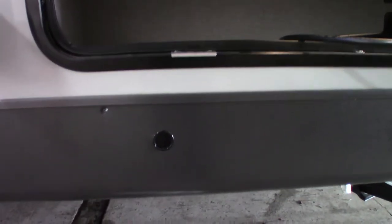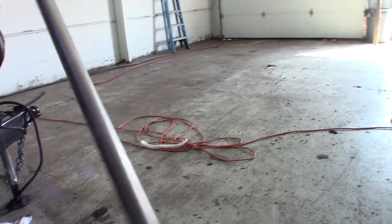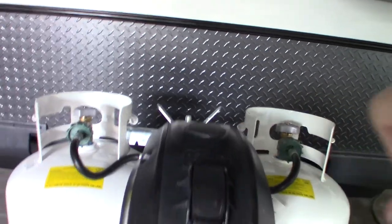So if you get into some kind of difficulty — whether the slide fails or you lose power — you can always crank it in and out in an emergency. Also in here is a crank for the power tongue jack. It has a smaller hex on it. If the power tongue jack was to fail, you could pull the plug out of the top, put the crank on there, and crank it manually to get yourself out of trouble — you can always get it hitched and unhitched no matter what.